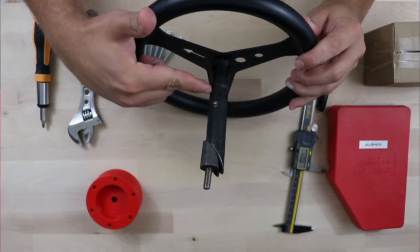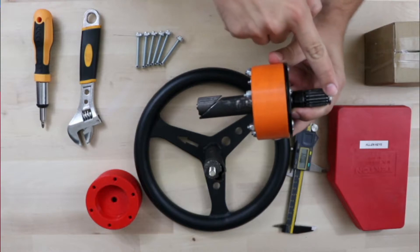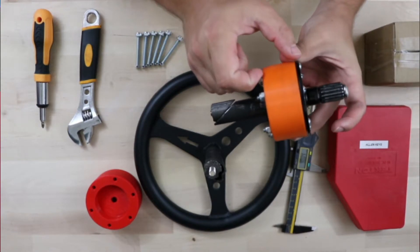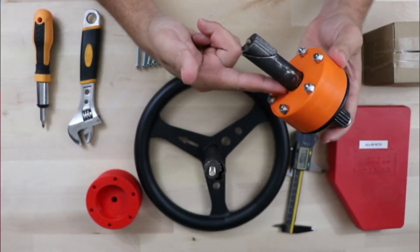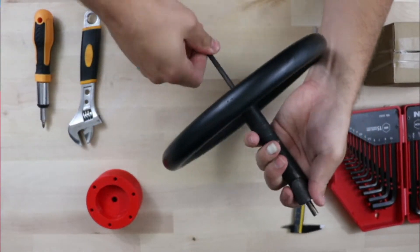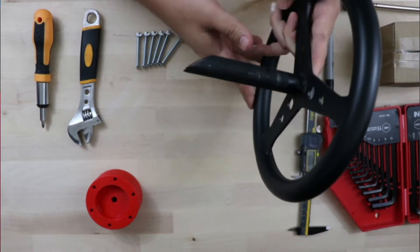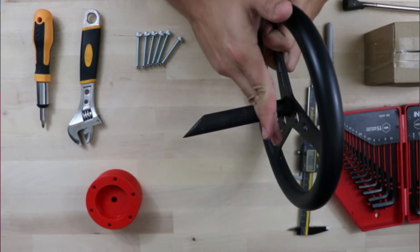The reason why we use 90 millimeters is because the shaft can only be so big where the bolt inside only has a certain amount of length, so it'll only go so far. The adapter takes up a certain amount of that gap, so we can only make the shaft so big to fit inside and have the correct size. I'm going to use an angle grinder with a cutoff wheel — you could use a saw or whatever else you need since there'll be enough gap to cut.